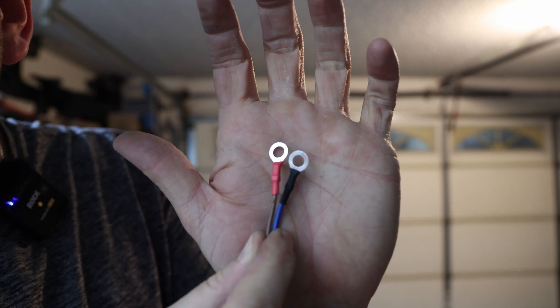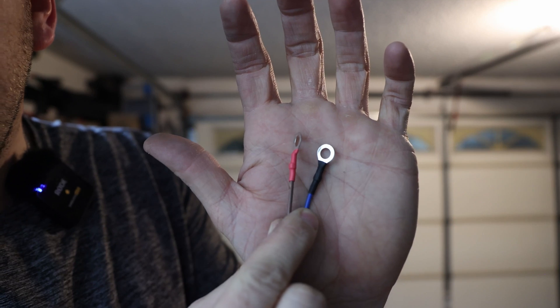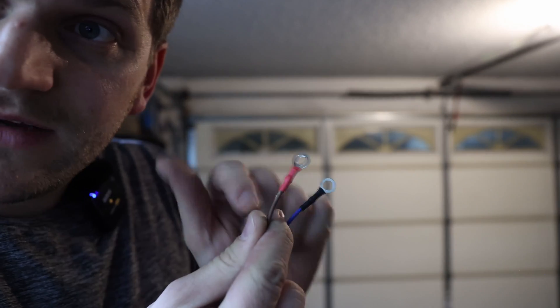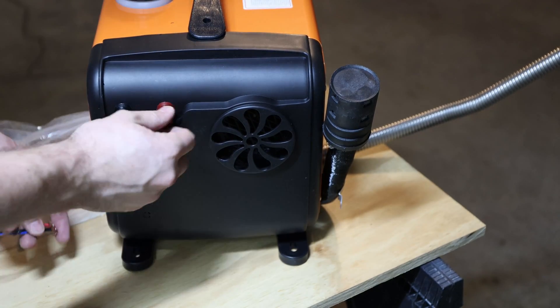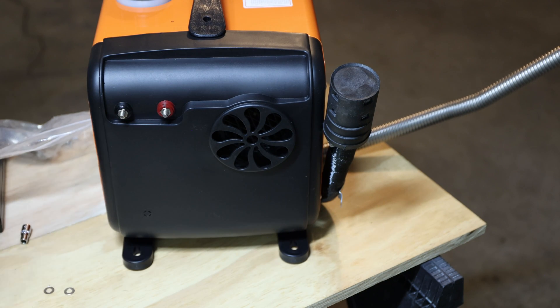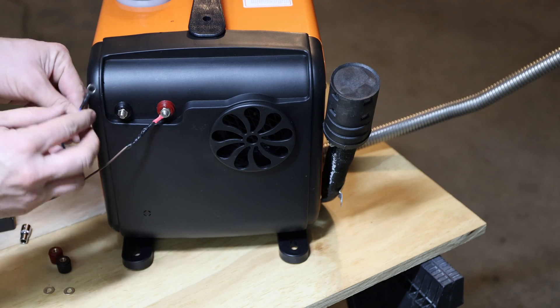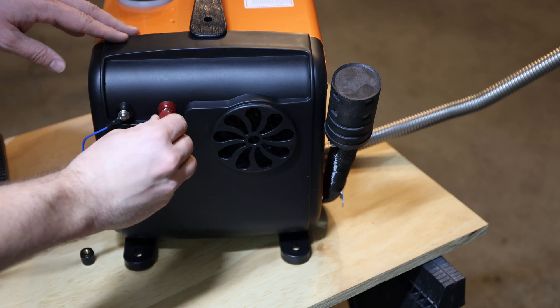Since it's pretty late I decided to wait with the actual test for tomorrow. The only thing I'll do now is fill in some diesel. In this video I'll use the 110-volt power supply. There's a brown wire and a blue wire — the brown one has a red heat shrink and the blue one has a black one. However, one has some burn marks and the insulation looks broken, so I need to fix that. Red goes to red, black goes to black. After adding a lock washer and spring washer, I use the appropriate color for each terminal.